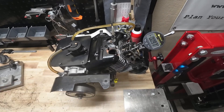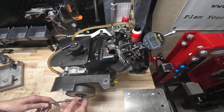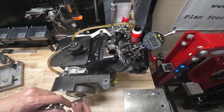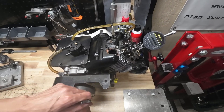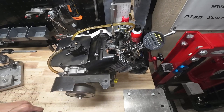Like I mentioned in the last video, this isn't a check I'm very familiar with, so I'm not sure exactly where these need to be. I was told that they should both read over 0.250 inches. So apparently this engine has a little less valve lift than is ideal, but it didn't seem to affect the power too much on the dyno. So yeah, that is how we check our intake and exhaust valve lift.